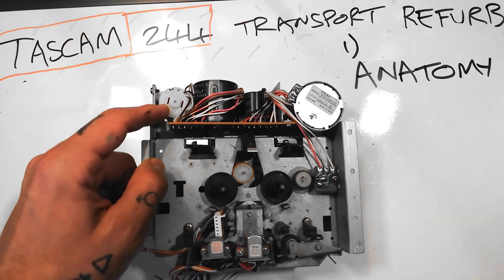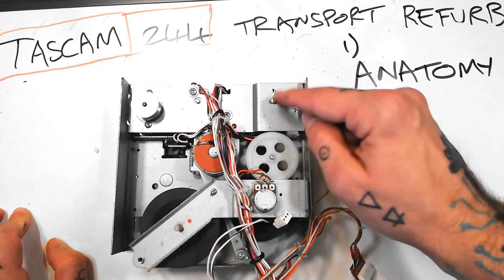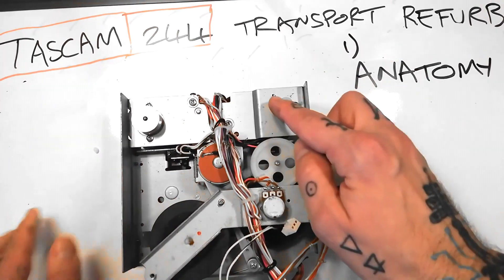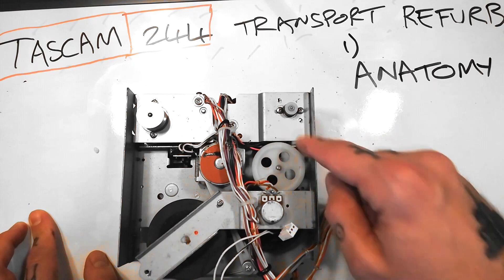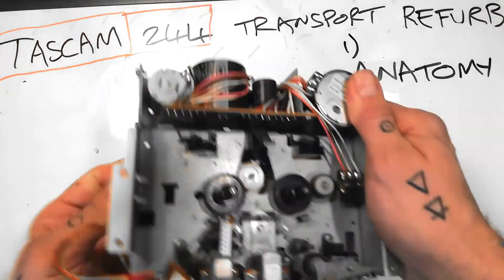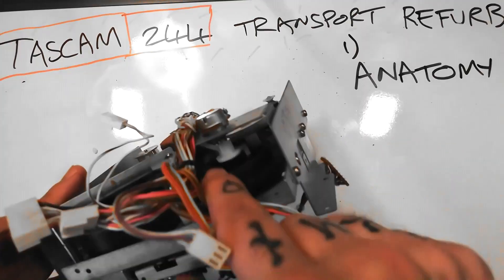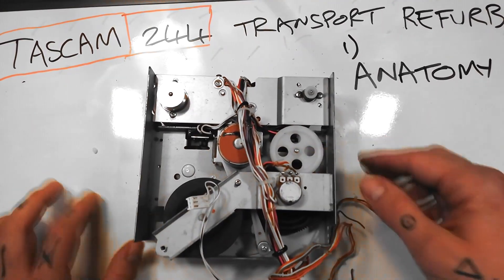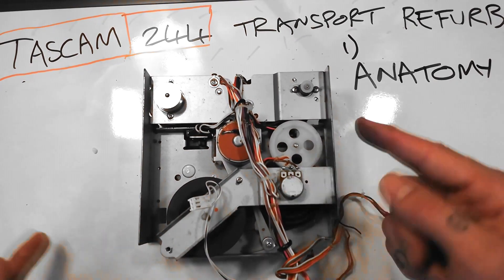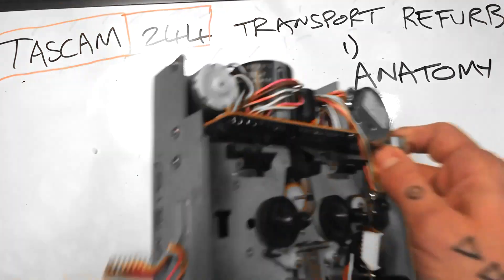And last of all, we'll come to the control motor. The way this works is a bit more complicated. It's turning here — this is the spindle pulley. There's a belt in there that causes that to turn, and as it turns there's a system of gears and cams in here. Essentially what that's doing — and I can demonstrate it manually — is changing how high or low the pinch roller and the magnetic heads are. It's also turning the spindle of this potentiometer. There's a logic system elsewhere in the 244 which is reading a resistance value, and certain resistance values correspond to play, rewind, or fast forward. That's how this unit communicates with the transport buttons.